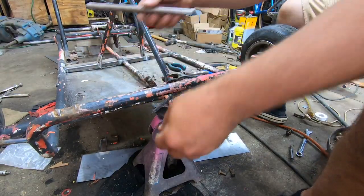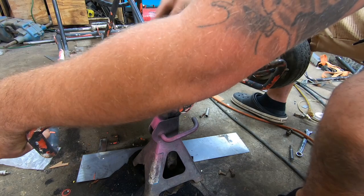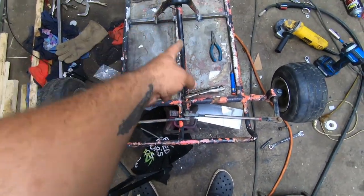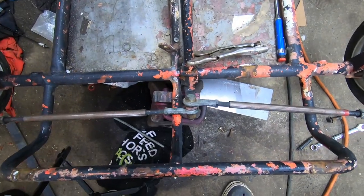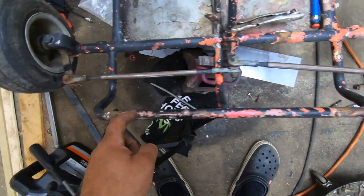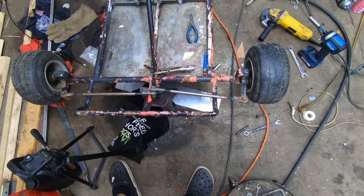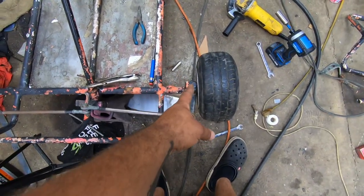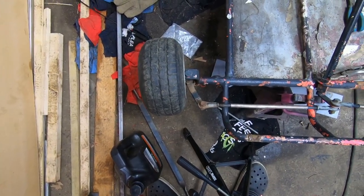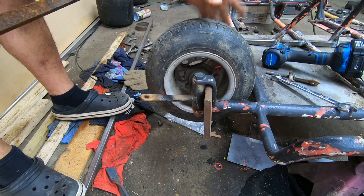This is kinda what we got going on here — we're doing the tie rods. I had this one section of tubing, and apparently I'm way off as we cut the tie rods. We got the steering shaft set up right in the center, and we're gonna go ahead and weld the tubing to the original tie rods, and then we're going to have steering. Although I just noticed something — look at this pitman arm, and then look at that pitman arm.